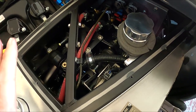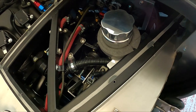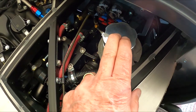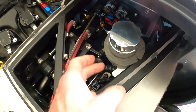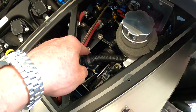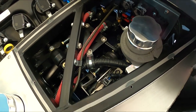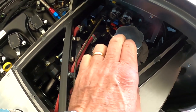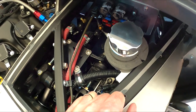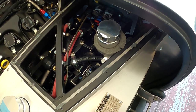Once I get the cover off, you can see what I've got here. This is sealed, by the way, to keep air from the hot engine bay from getting in. So I'm going to suck the reservoir dry, then pull the reservoir out. I think I can get rid of this one wire harness here, slide it back, and get access to unbolted everything. I want to get all the brake fluid out and keep from making a mess.